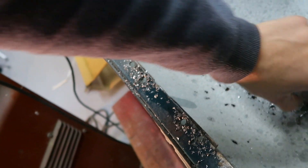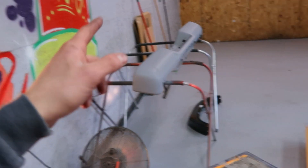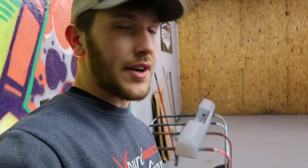I'm hoping to undo this bolt and this little one over here, maybe bend this lip up, and bring this side up. Then I have this piece in the back to weld in yet and I need to finish making sure I got them all welded. I drilled all the way through so when I go to put that piece in I can come back and plug weld all those holes up, then grind them down and it should look factory — definitely better than trying to come up underneath and weld.